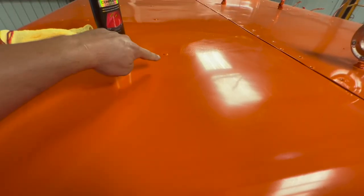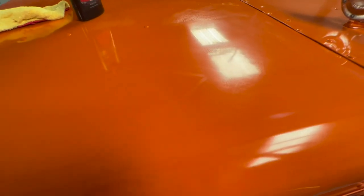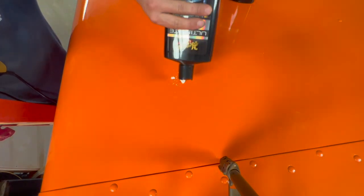Now that's only the first step in it, but I'm only working up to the first rivet here. It definitely looks more orange-peely over there and it's starting to smooth out over here. I'll go ahead and try the next compound and see if that makes a difference. Now we've got our finishing compound — let's try this out and see how it looks, and reassess if we want to keep going or change up what we're doing. This one says to run on medium.